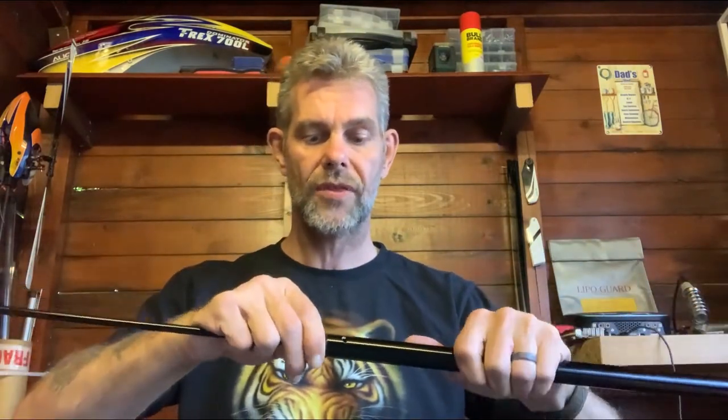We take our torque rod and we simply now pop that in and we slide that into the torque tube. We make sure that it's nice and level as it goes in. And once we've got that first rubber in, we can then use the end to push some equal force down all the way through. And likewise with this one, we can use this now to push the rubber and therefore exert equal force until the torque rod is all the way in.